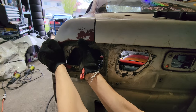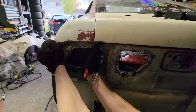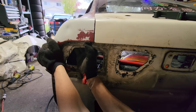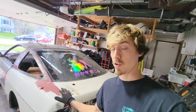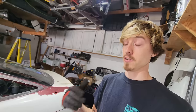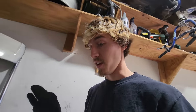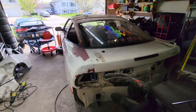What needs to happen is this hole needs to line up with that spot weld, and this little cap needs to align as well. Right now this quarter panel is sunk in too much because this rear clip is folded forward ever so slightly. When it's pulled back and this is pushed over we have a perfect gap — ideally this is where we want it to sit. The trunk doesn't have any bushings in it so it will actually sit up a couple millimeters higher, which is exactly where we want it. This spot weld is lined up perfectly. I do a lot of talking about my thought process — my favorite thing is to test fit over and over again to verify everything is good, because once you weld it in it becomes a whole other issue.